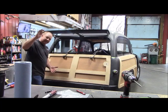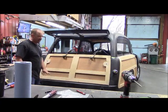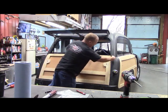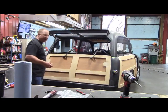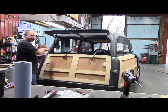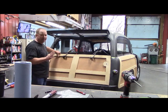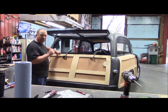It'll be a little bit more at the bottom — it's got a swing up underneath there. On the front face the gap's going to have to be a little bit bigger at the bottom. But then I get all that worked in place, then I'll come back and mark on the edge of it all the way around. And that's going to give me what it's supposed to look like as it rolls down. Then I'll go back out there and blend that over. This will be a great fit. I wish the sides were going to be this easy, but they're not going to be near this easy. So this will give me a good practice for starting on the sides.